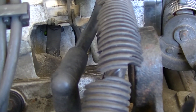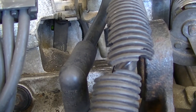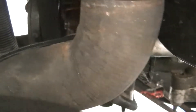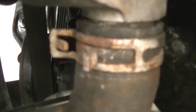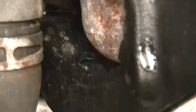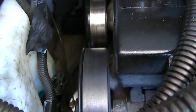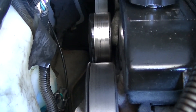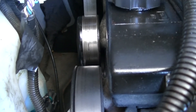I have a nice low idle, right around 700 RPM. Based on what I know about these motors, I can be pretty well assured there are no vacuum leaks. There is the little sensor from the external crank trigger — the original one that's on the 3400 but not present on the 3500 — I just lashed it to the dog bone support bracket to keep it out of the way of the serpentine belt. The serpentine feels just a little bit tighter — I had to pull the idler a little harder to install the belt — but either way it looks factory and nice.